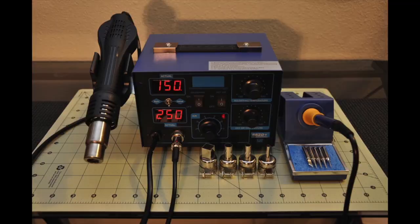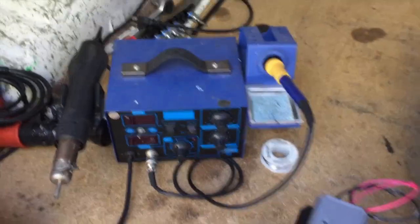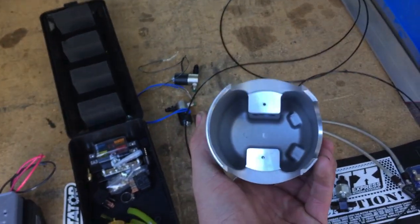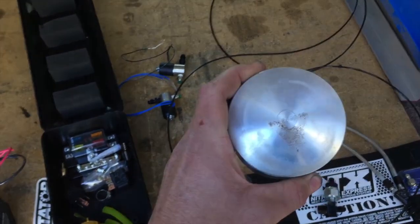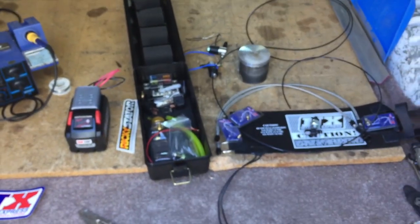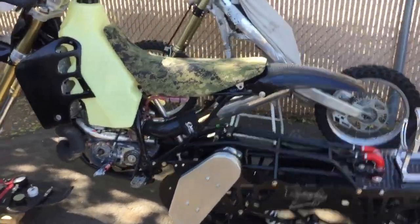I'm going to solder the wires. Here's my last piston — I'm really curious about piston wash. The bottom of the piston is light brown because the piston was getting hot. I kind of wiped off the wash but there really wasn't any wash on there. My bike was running super rich with my initial jetting at 12,000 feet.